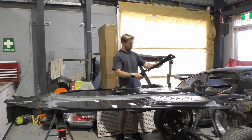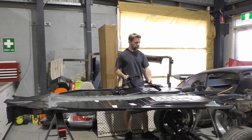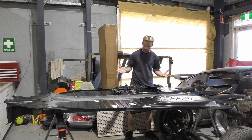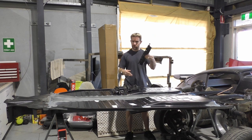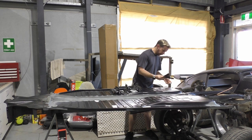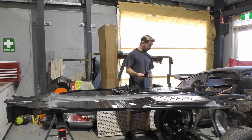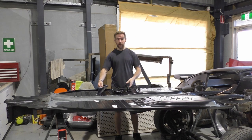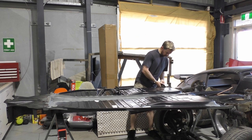From where it's actually been welded, it's on the inside runner, which, wow, that's really weird. The existing parts of the chassis itself, these little hooks, they're in the way. So if I was, for argument's sake, to chop off the existing ones and then use these and just put the whole pan on, which, to be honest, probably would have been a lot easier anyway, I still would have had a bit of a problem because where it needs to weld on, it would have been sticking up a lot higher. But I suppose just build the weld up there, but anyway, that's just gonna be a factor of chopping that down a bit more so that it then sits where it needs to.